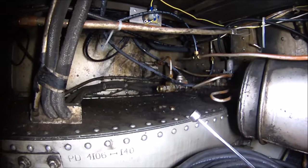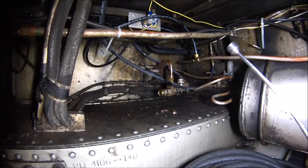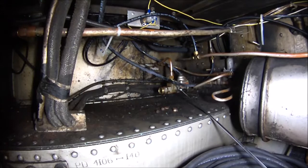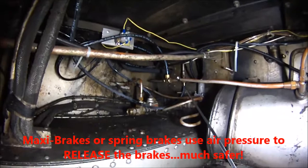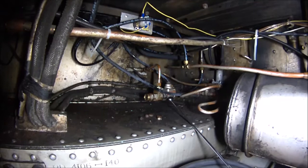While I'm in here, I'm going to clean this compartment — it's always been something I wanted to do. Everything in here has been here for 35 years and longer. This is the supply line from the air tank, and this valve here used to be a check valve that was part of the ICC brake — a hand brake with an air valve the driver could flip to apply the rear brakes using air pressure. When you take that hand brake out and put in maxi brakes like I did, you take these tubes off. I left this valve in because it's just designed to let air flow through.